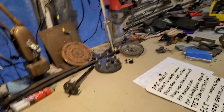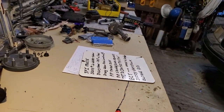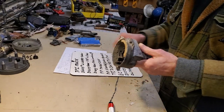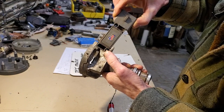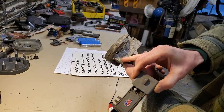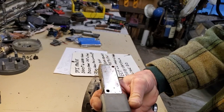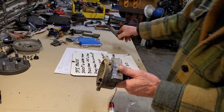It's not every ignition module — it has something to do with crappy aftermarket parts. If you have that going on, you end up in a situation where the two screws you attach here will twist and twerk that sheet metal on the back, and that sheet metal is integrated into the electronics of the module.